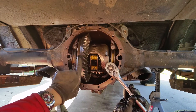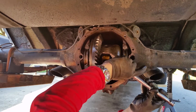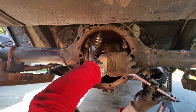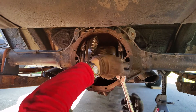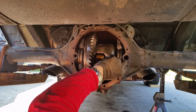You could use a spacer right here and go all the way up to 4.11s if you wanted to use 4-series gears in a 3-series carrier. You just got to buy a $30 spacer and it comes with its own bolts. So a 3-series carrier is the most desirable — you can go from 3.08 all the way up.